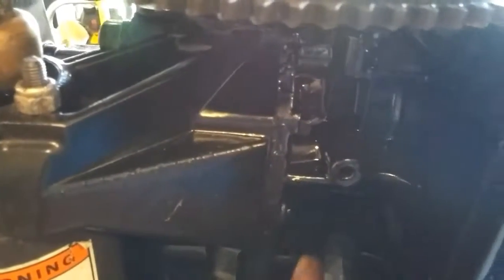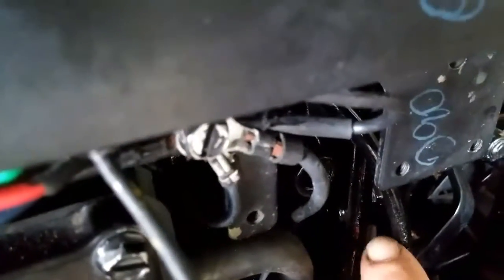What it does is seal the crankcase halves. I had actually shot a video but something was wrong with it — it wouldn't load right, so it's forever gone. There's also a flange on the upper seal bracket that holds the stator and whatnot, and it's also got gel seal on it. It's critical that you use only that, because whatever doesn't get squeezed out stays gooey. See how it's right here? It's still gooey.